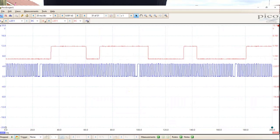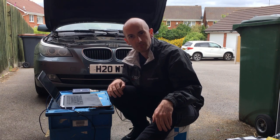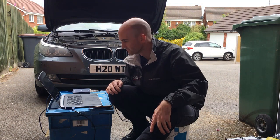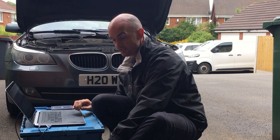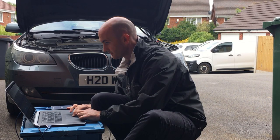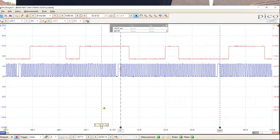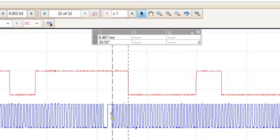Let's just stop it there and take our reference measurement. So we went from here to here — we've now got six milliseconds on that gap, compared to eight milliseconds before I replaced all the timing gear. So now if we do the degree measurement on the good trace — the good timing chain — pulling across to that first reference point and then 360 degrees on to that reference point, and bringing our other ruler in from the left-hand side, we've got 30 degrees.